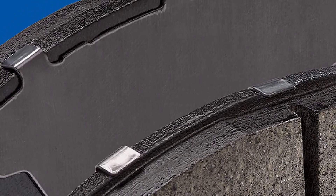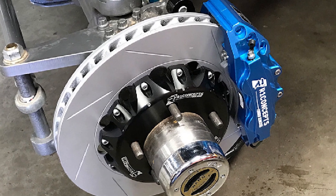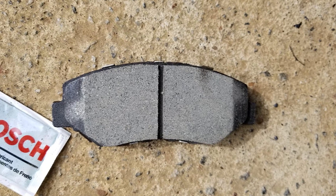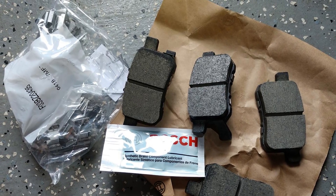The ceramic material and copper composite linings make much less noise, do not damage rotors, and create virtually less dust than metallic linings. The high thermal stability, characterized by a high and widely constant friction coefficient, guarantees good braking and noise behavior even on harsh road conditions. As far as price goes, ceramic brake pads tend to be on the higher side, and ceramic brake discs are used in many sports cars, high-performance premium sedans, and sports utility vehicles.